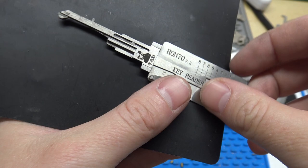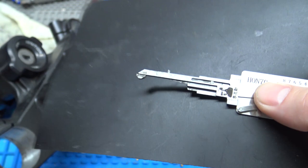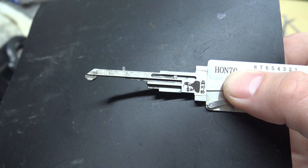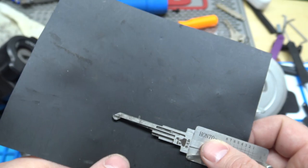One feature here — this little piece right here actually changes where the shoulder is, so it can be right there, putting the Lishi out of the keyway a little bit, or if it's this way then it goes further in. The reason it has that is there's actually the HD 109 keyway — there's an HD 109 blank and there's an HD 109A like Apple blank, and the shoulders are in different spots on them. I've never been able to find any reference to tell you which bike uses what, so basically if you make a key and it works the gas cap and the seat, you've got a good code. Cut it on HD 109 and if it doesn't work the ignition, tip-stop that key and cut it on an HD 109A and I bet it works on all of them.